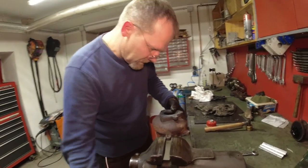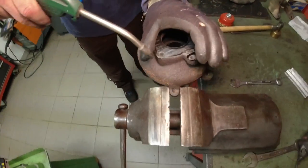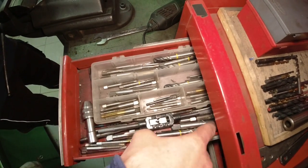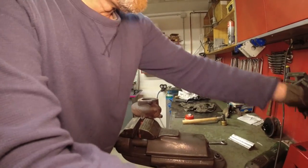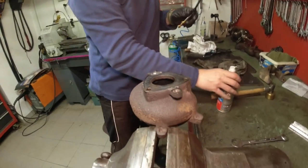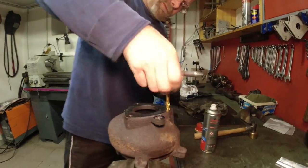Now what we've got to do is actually rework these threads. Watch your eyeballs. You don't have the perfect size? That's the right one — M10. I wonder how we did everything without that cutting oil. See, there is a lot of garbage in there — studs.